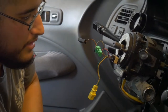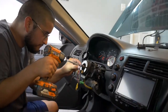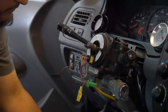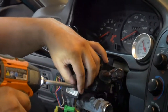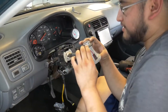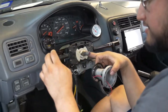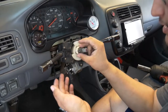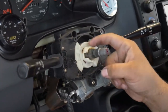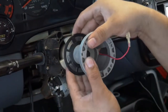Now we've got the stock clock spring exposed. I'm going to pull off this clock spring and install the $10 eBay hub. What I'm working on right now is figuring out which way to align the hub. This is the cam for the auto-cancelling of the blinker — when you turn the blinker during a turn, this shuts it off. It has two little pieces sticking out that you've got to line up with the back of the hub so it rotates with the steering wheel and auto-cancels the blinker.